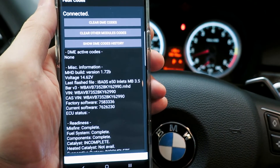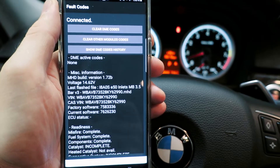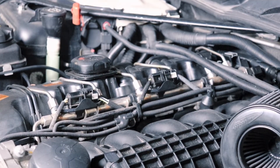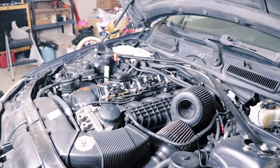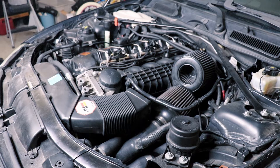That's a really easy way to determine if you could have a bad oxygen sensor. It's not a definitive answer because you could have something going on with your MAP sensor, etc. — anything that would force an open loop situation will cause the car to run smooth. I'll demonstrate that right now by forcing an open loop situation by disconnecting the oxygen sensor. It's like the problem went away as soon as I did that because it can't reference the oxygen sensors anymore. It just has to go back to the ECU and run off a preset value, which would actually be kind of rich and your car would get terrible fuel economy if you left it this way — it'll at least get you home worst case.